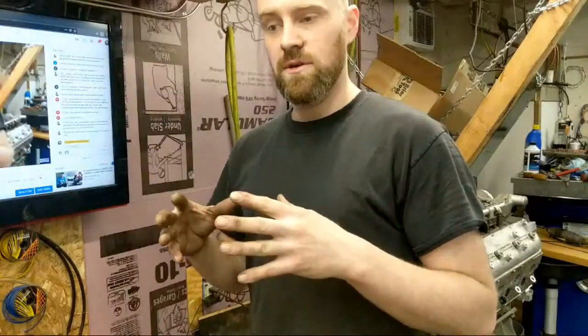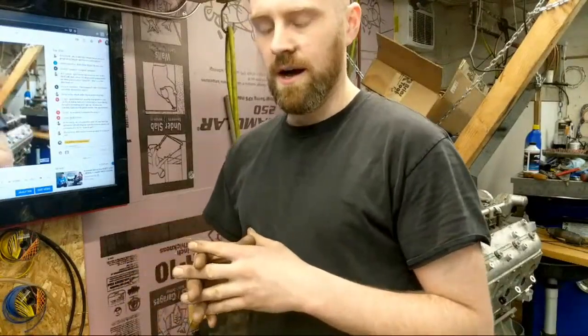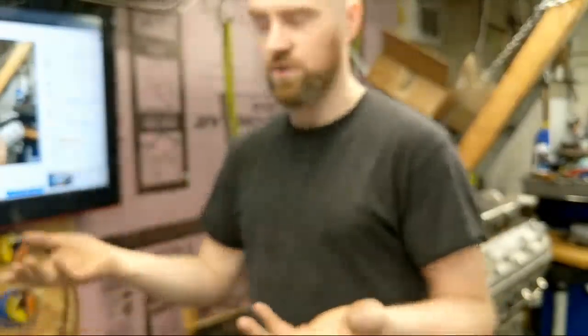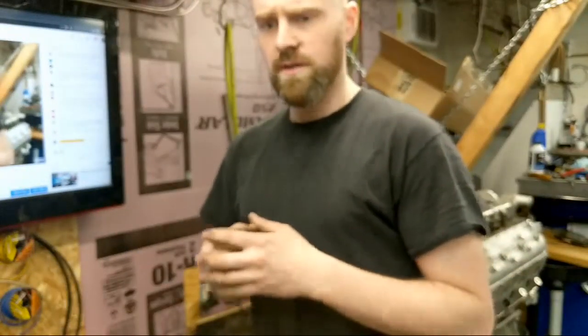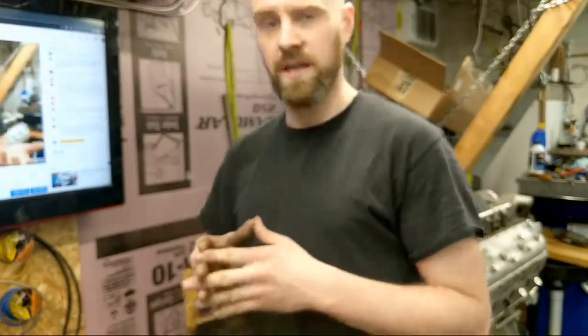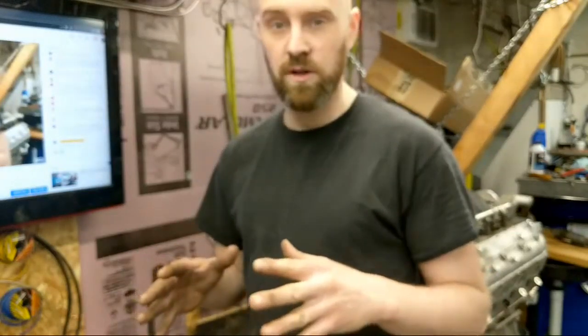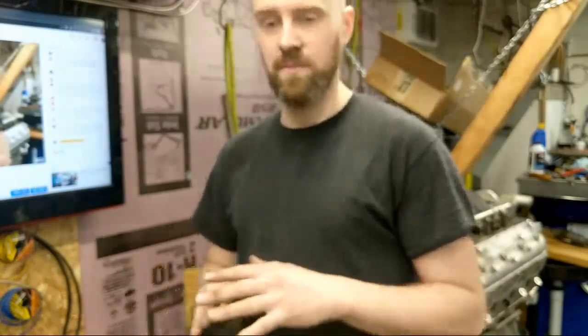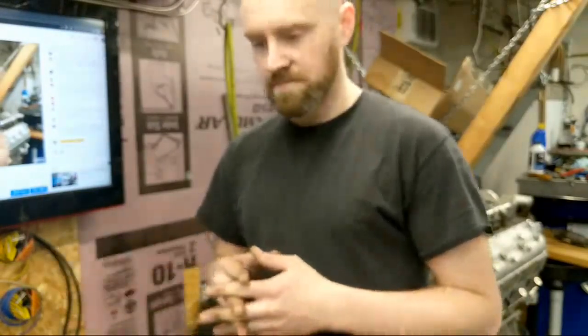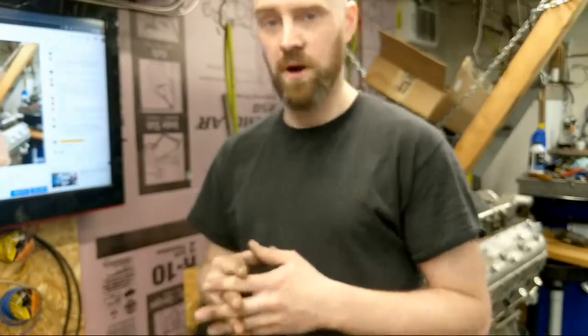It was locking up. So this morning, hopefully he's working on it, but I'm hoping that he's going to find out that that VLOM somehow malfunctioned and is allowing oil pressure into the passages. Because this was before I did any kind of VLOM modification, obviously. I just recently discovered doing that. So this guy has gone, I think it was 60,000 miles, and hasn't had a problem until now, but he also hasn't maintained his engine at all. He hasn't been doing his oil changes like he should. The engine's complete filth. He said it just looks like a nasty, stereotypical Pennzoil motor, where it's just sludge everywhere. He said it's just disgusting. So I would assume that that has a huge part to do with the problem.